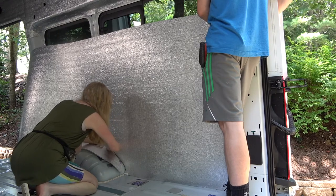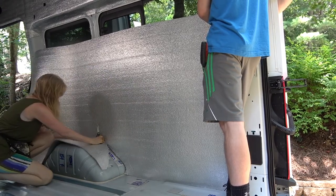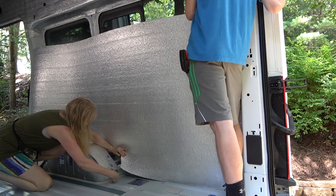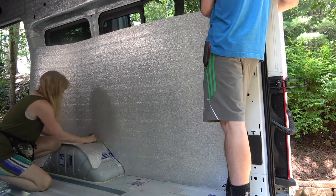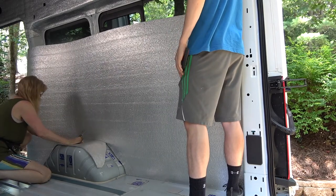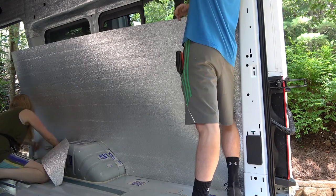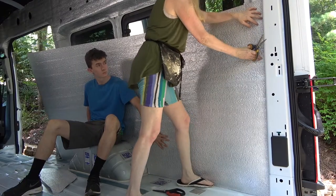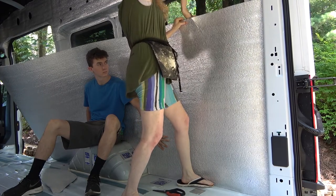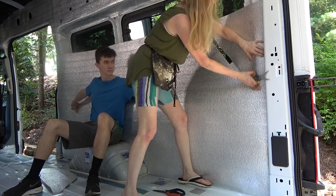When I do it this way, it releases so I can continue to make it flat. Okay, so I've released that edge. Now I can flatten that out. I couldn't do that earlier without making that cut. Okay, so I'm just pushing it into the seam. Now I need another cut over on this side for it to continue to lay flat. Okay, so we're all the way over to this side. Now I'm going to cut toward the corner. See, that allows it to be wrapped.